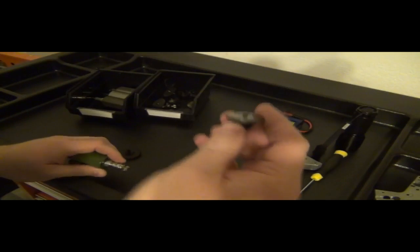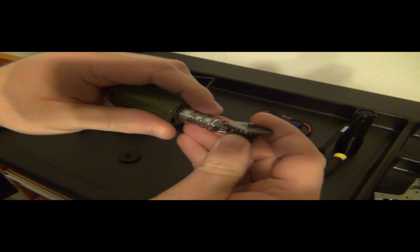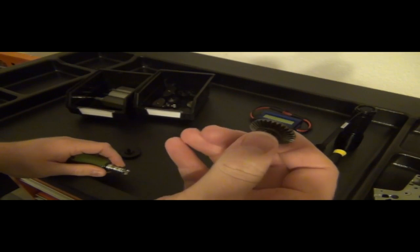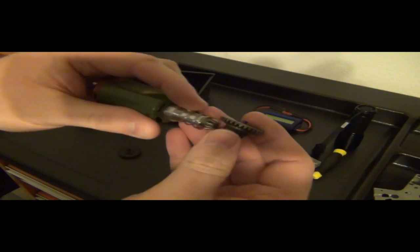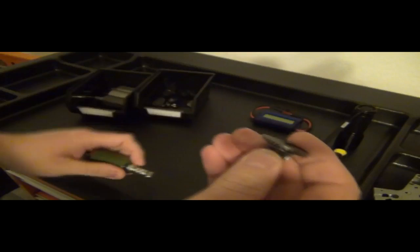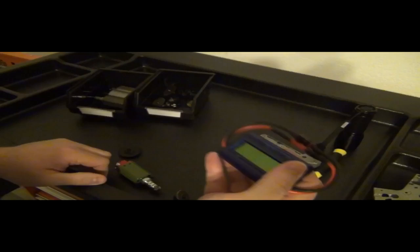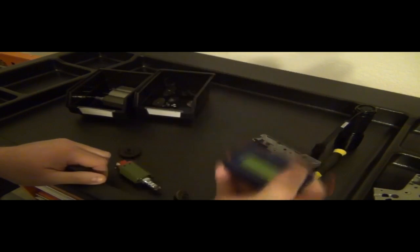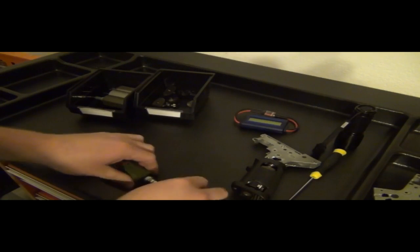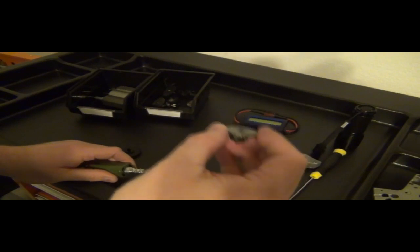But for some reason, people think that if you take this motor with a pinion and you shove it, pushing pressure against the bevel, it helps it spin better and gives a better noise. Of course it's going to give a little bit of a better noise. It can't spin very well and it's pressured into here. Okay? Mechanically this is going to show more amperage because it has a much harder time to turn. It is proven fact. My test will tell you, and you will see that this is not level, not flat, not parallel in the gearbox.